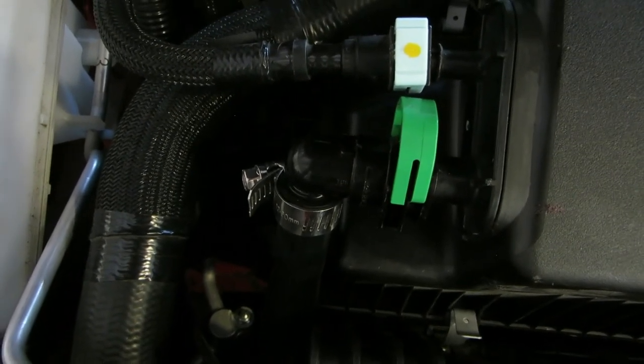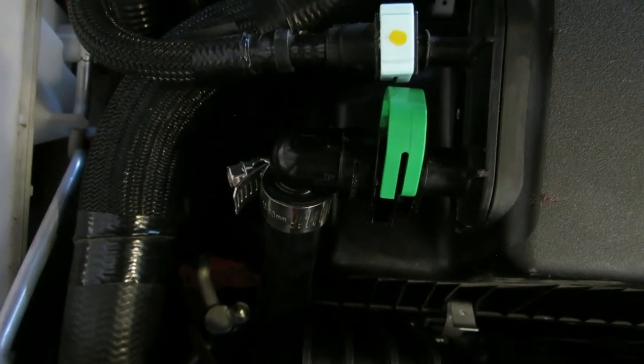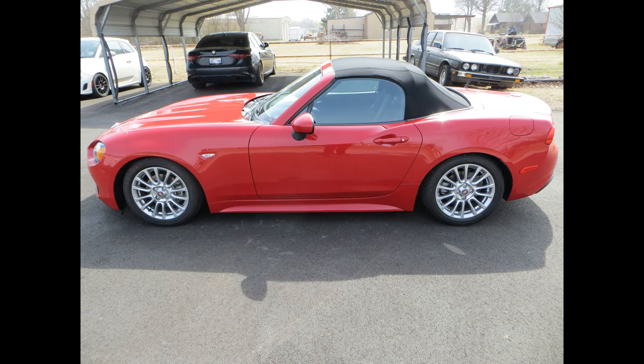If you're using upgraded piping, that's usually not going to be the issue, but if this pipe is not solidly connected and leak-free all the way, that'll cause a code. With a stock intake, the problem really has to be those connections — there's very little else that can go wrong. There are some check valves and other hoses that conceivably could fail, but I've never seen those components fail on a Fiat. They're rock solid and reliable. The problem is almost always the connections.